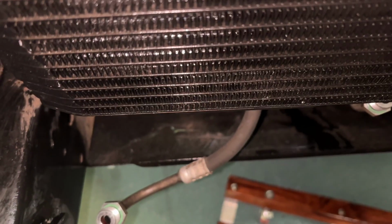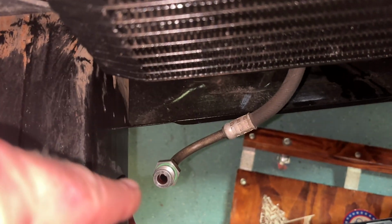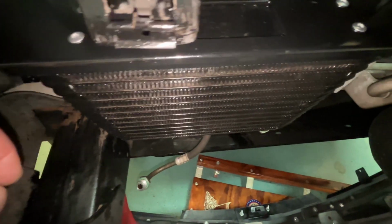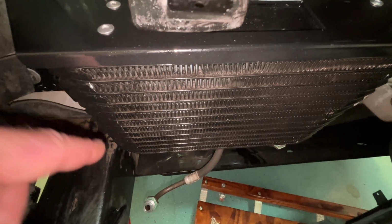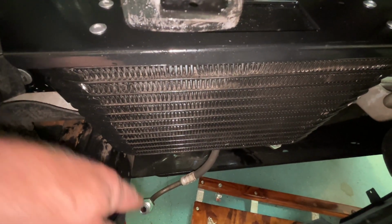Amazon part alert. Gotta shut down this operation because the original OEM fittings on this vehicle are not matching up with this cooler I got from Amazon. So I'm gonna link it in the description so you can check it and make sure you're not gonna buy it, because the fitting location here at the bottom is too small for that.